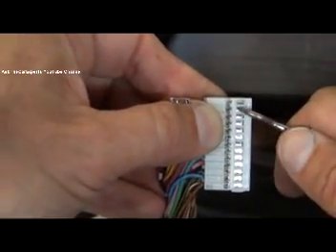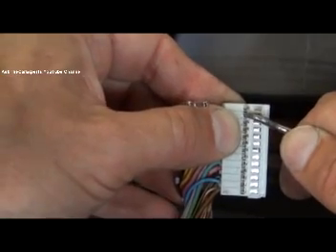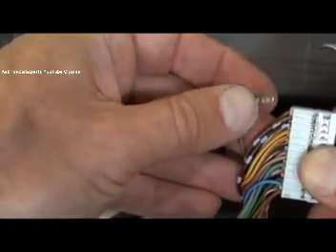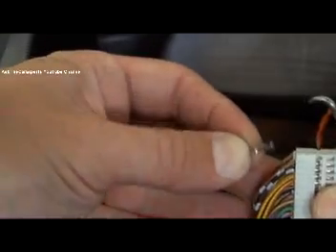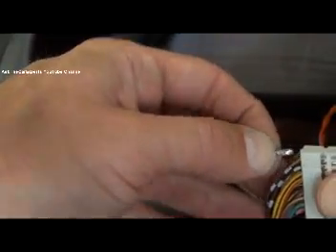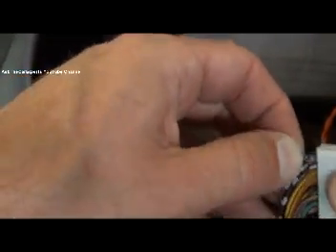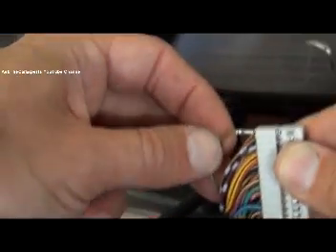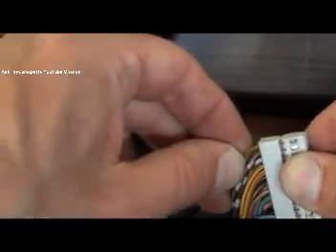The pin locks here. Push it back — it will get stuck at the first catch. Push that locking tab down again and it slides right out. You can see it's the female style connector with a little locator, so if you tried to put it back in sideways it won't work. Slide it back into place and it'll lock in — make sure it's secure. That's how you remove any of these pins on either side if you want to check or replace a pin. There are a lot of connectors on BMWs that work just like this.